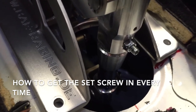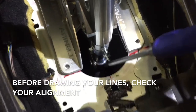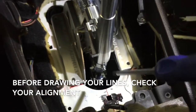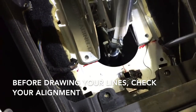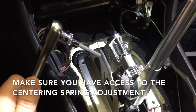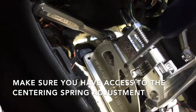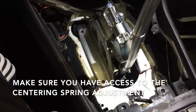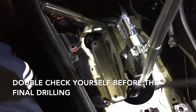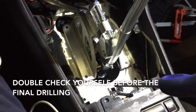To continue that thought, you want to make sure that your selector rod and your lower rotating assembly alignment is directly in the center of that hole. That's going to give you a straight shot to the transmission and through the transmission tunnel — having that straight alignment through the middle is going to give you better and smoother shifting. You need to make sure that you have access to your centering spring adjustment, and that is through the front of the shifter. In this position, we have just enough room for access to our centering spring using our hex key. We have good alignment, access to the centering spring, it's centered, and there are no rubbing issues. We can drill some holes and continue fitting.